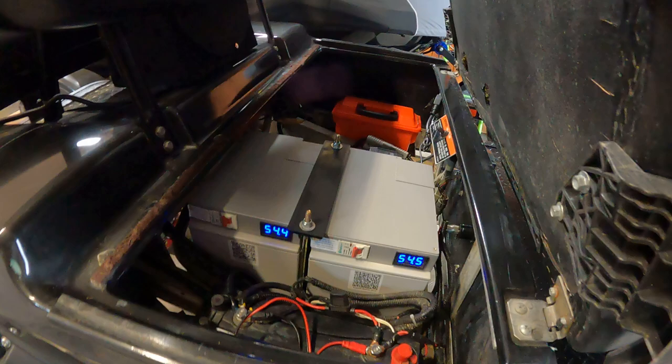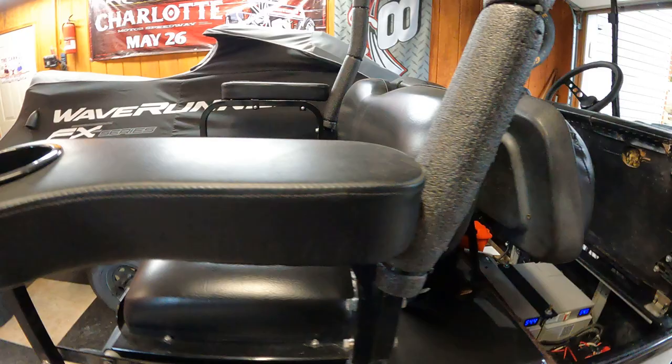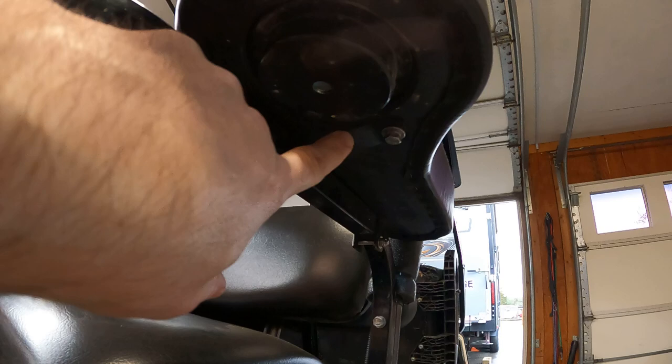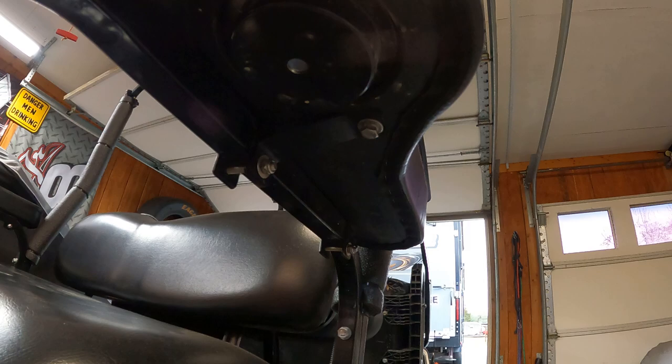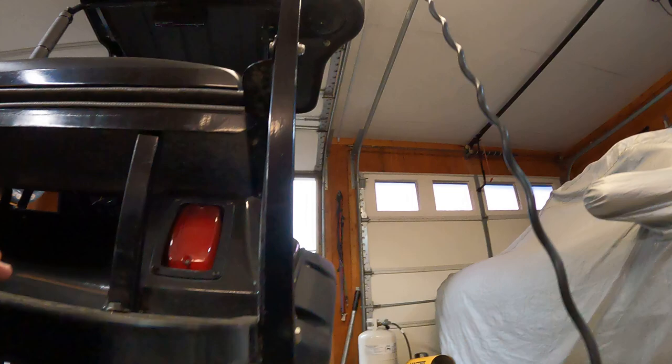The Eagle batteries are charging now and sitting at 54.4, so they're about charged. I've got a USB charger for phones here running off the one Interstate battery at 12.6 volts — always nice to know. I put a rear seat on here, and if you want arm rests, get the ones that have a little metal extension. The other ones don't hold up, and these weren't too expensive — maybe about 40 bucks. Make sure they have that proper metal bracket.